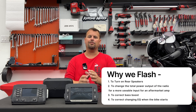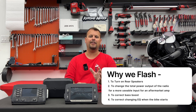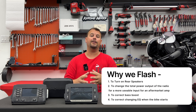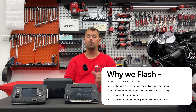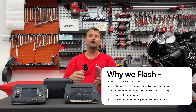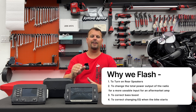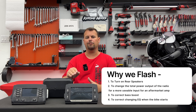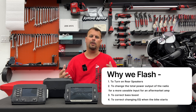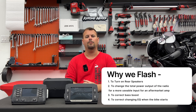The flash is also going to correct the crazy bass boost that Harley has. It's a very large — 12 to 14 dB — bass boost in the background of the radio that's trying to blow your speakers. It's actually at the frequency that most six-and-a-half inch or five-and-a-quarter inch stock speakers cannot handle without wanting to distort or even blow after long times of being played very loud. So we're going to correct that so that when we put our new better speakers in and our big amp, we're not amplifying that bass boost and trying to blow our new speakers. It's going to make your system last a lot longer and sound much, much clearer while you're riding.